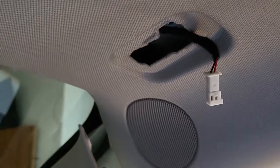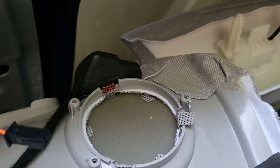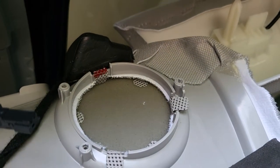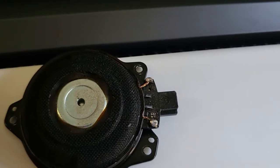I have things taken apart here with the visor down. If you look up in here, I've pulled this down — that little dot is where the speaker was hitting. The speaker goes right in that hole, held by three screws and plugged into that cable. When it goes back up here, it presses against this area, and I'll show you which part of the speaker is rubbing there.